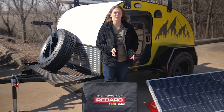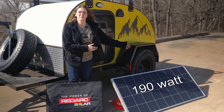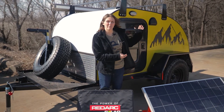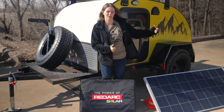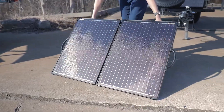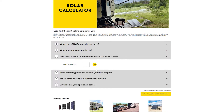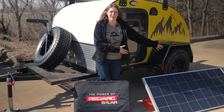We're going to start with a small solar setup. This is going to be appropriate for a small camper like this teardrop that we have here. We're looking at about 200 watts of solar or less — here we have a 190-watt panel as an example. Space is going to be one of the big limiters of solar panels when you're trying to put them on your RV. As you can see here, we don't have a lot of space up there, and this one doesn't even quite fit on top of this particular rig. So you'll want to measure carefully and figure out how many panels you can actually put on your roof before you start investing. Another great option is a portable solar panel, which you can use away from your camper so you don't have to worry about sticking it on your roof. We ran some numbers through our solar calculator on the eTrailer website and determined that with a single 100 amp hour lithium battery in Missouri for two days, we could run about six hours of laptop charging, a couple hours of LED lights, and an hour or so of a fan with a 190-watt panel.